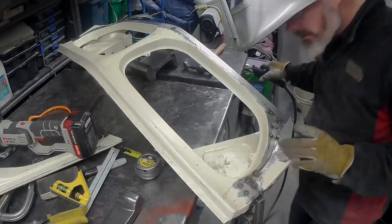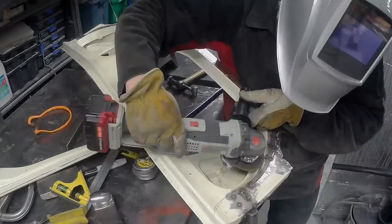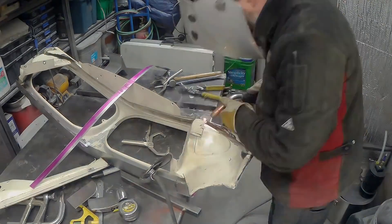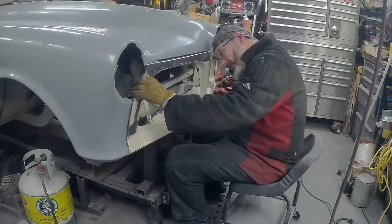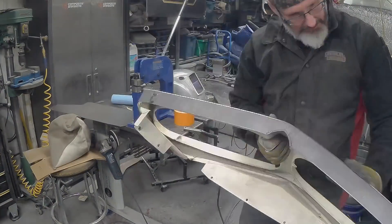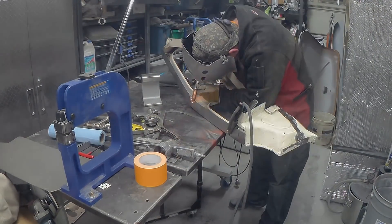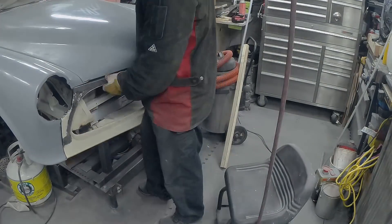Even as I'm putting in the template I made with tape, I find that I have to adjust the line — and I do that just with the grinder, very carefully, just skinning on the edge so it fits in perfectly. If I could render this in steel, no problem at all when it's done. I could finish weld this up and you'd barely need a skim of Bondo. This is the first test fit onto the car — I was going to count how many times it went on and off, but it was a lot. If the shape wasn't quite right, that's why I've got that great big deep stretcher and shrinker — easy to get the panel in there and do whatever little work I need to do. Just little bits of dolly work here and there.